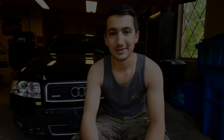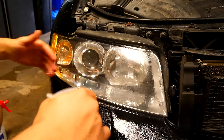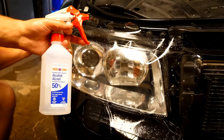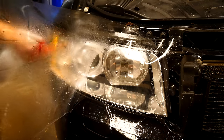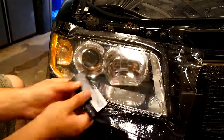You want to go over the headlight too with the isopropyl alcohol — this is going to remove any of the waxes found inside the polish and give us basically a naked headlight. To apply the paint protection film onto whatever panel you're working with, your hands need to be incredibly clean — they can't have any dirt on them, otherwise you'll see those fingerprints on whatever panel you're working with. Your hands should also be covered in the soapy water solution I have made up. In this little bottle I have regular Dawn dish soap mixed with regular water. This is going to allow the paint protection film to slide around on the surface of the headlight without it adhering. You're going to need to use a solution which is a 50-50 mix of isopropyl alcohol and water. Apply it to the back side of the film and you'll be able to squeegee the film onto the headlight and it's going to stick like glue. With one half laid down, do the same thing to the other half. What's nice about this film is that we can replace it should we want to — if it gets to be super corroded, super pitted, or really dirty, all we have to do is peel back the whole thing and reapply a new layer of paint protection film.